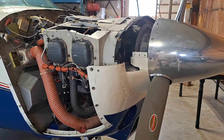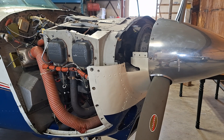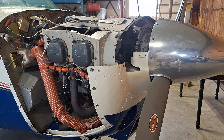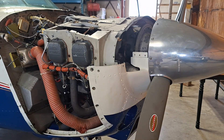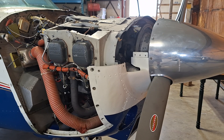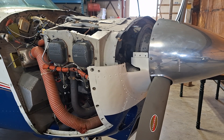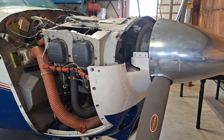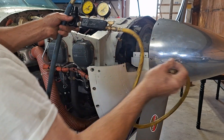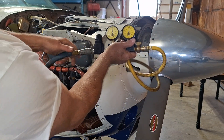I've got an airplane in here and I'm doing a compression test on it. I'll do a short video tutorial on how I do it — I do it according to AC 43.13, the way it's published in that book. First thing you do is take all your spark plug leads off, pull one spark plug out — usually the easiest one to get at — so that you can hook up a tester to it. Then you want to make sure your gauge is accurate, so this is a compression tester.